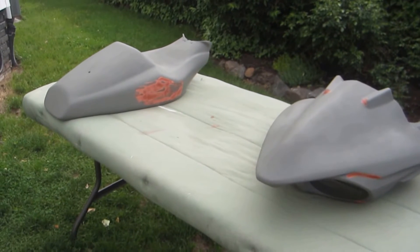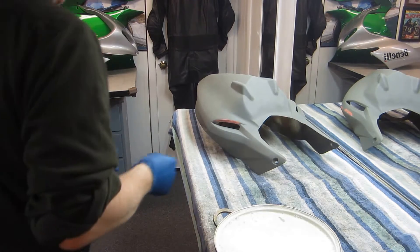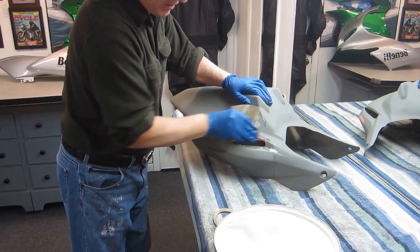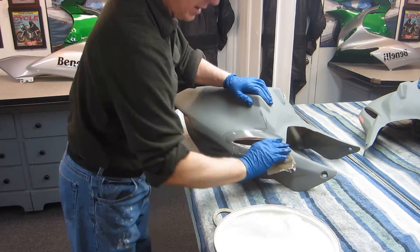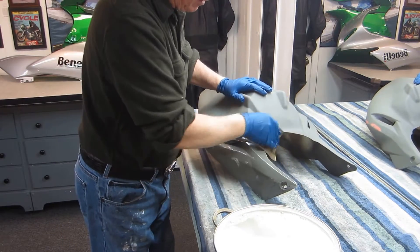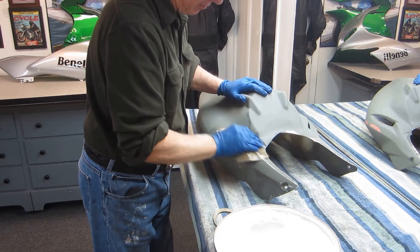The good news is, while I have my breakfast that could be drying. By the time Glenn gets here, he'll be ready to go to work. This is the Rhino Wet 400. I want to do all the body work — the little spots like around these scoops — get as much done as I can before Glenn gets here. Any spot that has an edge, you can see the edges come right through. The most important thing is to get around all the edges, because if you don't, that's where the paint will start to peel and chip, no matter what level of finish you put on it.